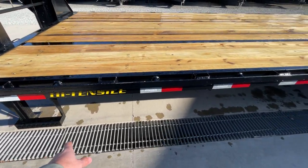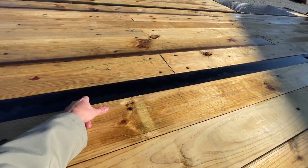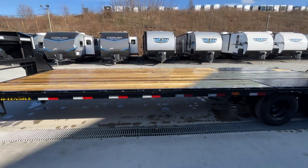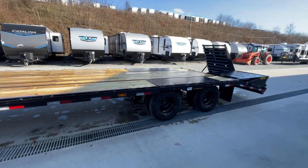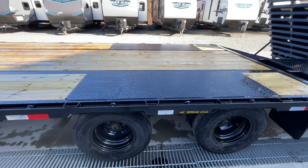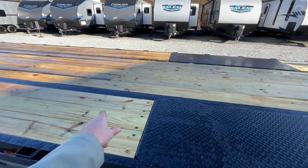We've got a step up front on both sides, and two-by-eight pressure treated decking. I want to point to the I-beam mainframe — it's a pierced frame, which gets you down to about a 32-inch deck height. Typically deck-overs are going to be about 36 inches. Another way to tell is if they've got tread plate over the wheels — that's generally a telltale sign. But if you see the I-beam, it's definitely going to be a pierced frame.